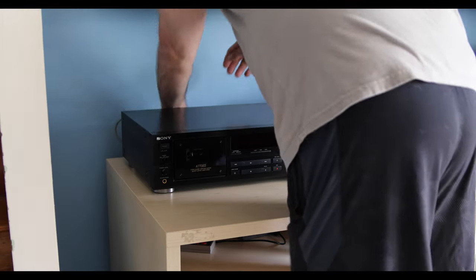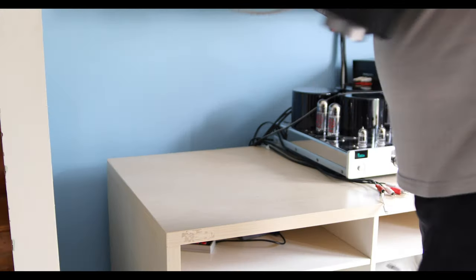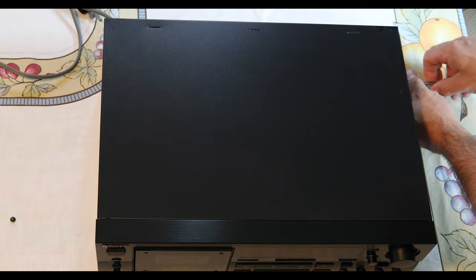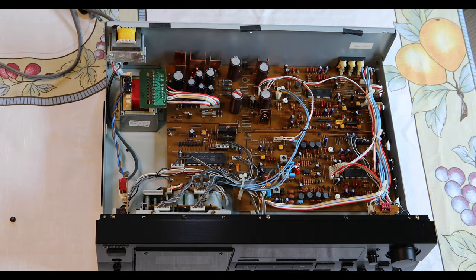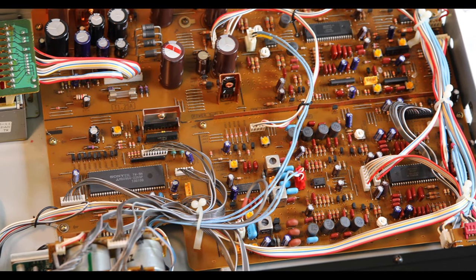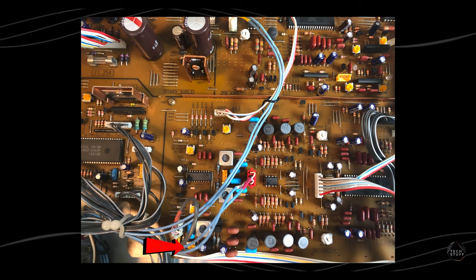If you've watched any other videos on my channel, you'll know that I like to crack these open to take a look inside, so let's do that. In typical Sony fashion, there are four screws holding down the lid, so remove those and lift off the top to expose the inside. Now that it's open, I'm really only looking for leaking or bulging caps, or anything else that might stand out as a potential problem. I'm also noticing there are a lot of pots to make precision adjustments to things like recording levels, tape bias level, and almost anything that has a level — so this is yet another thing that sets apart the ES from a typical deck.